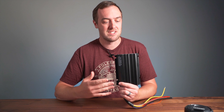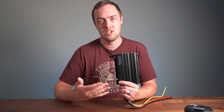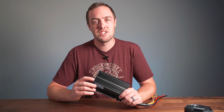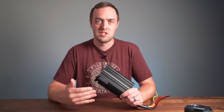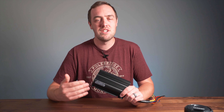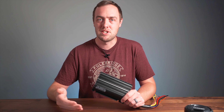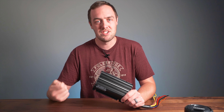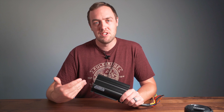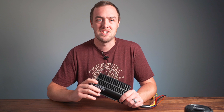You can see how compact it is — it takes up very little space and it's completely sealed, so you can mount it under your hood if you've put your second battery there. DC-to-DC charge controllers are designed to protect your starter battery and won't charge your second battery unless there's enough power to do so. You just turn on your engine and go — no buttons to push, switches to flip, or anything to plug in. There's no way you can kill your starter battery if you forget to flip a switch or turn the ignition on without starting the engine.